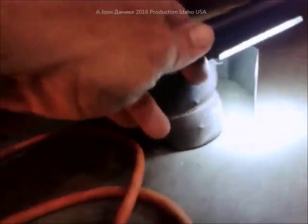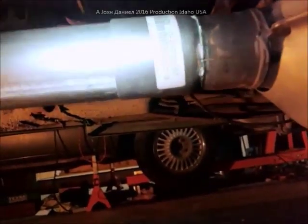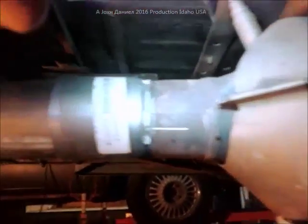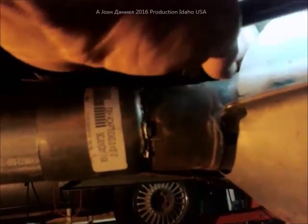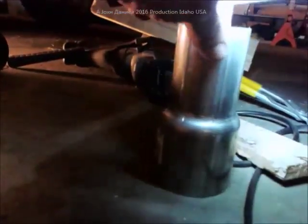It's got a resonator around it. What I've got here is a cutaway right at the catalytic converter where I've pulled away all these materials and split the existing pipe piece. What's going into this is a two-and-a-half inch fitting - you can see the model number there. These Ford catalytic converters for large engines like the 460 have been serviced to be more functional, and the oxygen sensor has a tab in front of it. You've got this reducer fitting for two-and-a-half inch pipe.